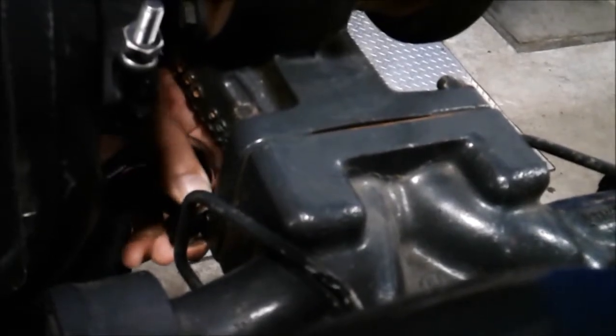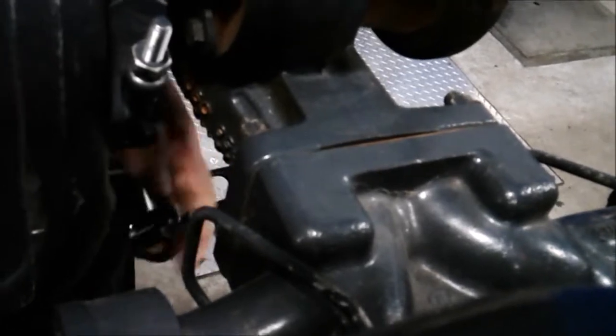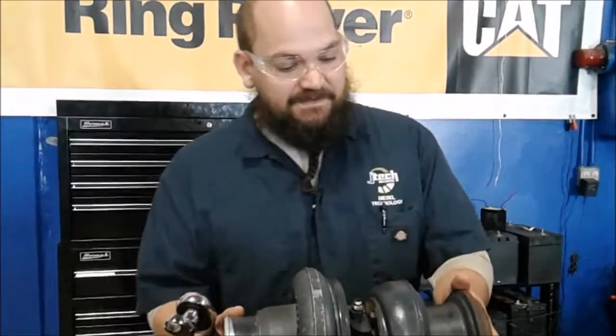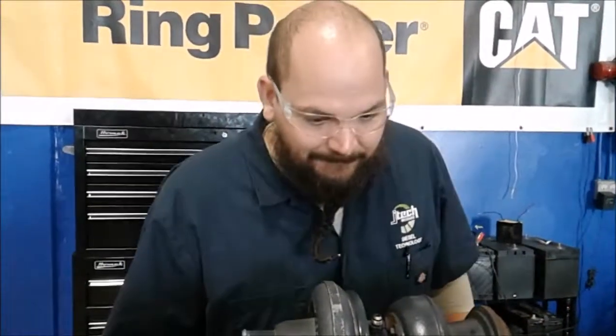While I'm doing this I do want to say that when you are complete, go ahead and — like I said earlier — make sure there's clean engine oil that can flow in and drain out, and reconnect your tubing for the exhaust and inlet side and run it. Make sure to test it correctly. I want to say thank you for your time — have a good day.